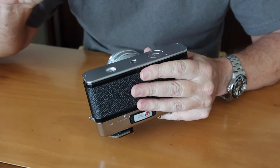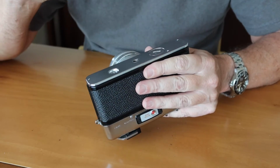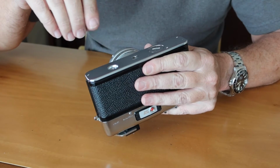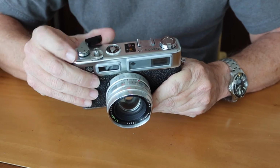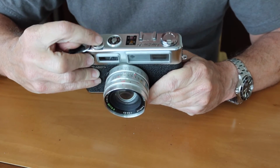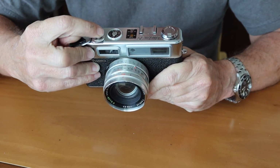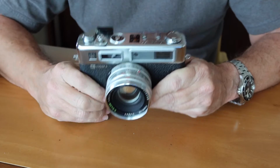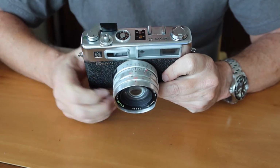So what you do is you put some drops of naphtha or Zippo lighter fluid or whatever you have like that. Put quite a few drops on it, and then turn the camera upward and hold the shutter like this and just cycle the shutter a few times. And the fluid and the friction of the levers will clean off any gunk which is on the contacts. And then the buzzing and funny noises will go away, and so will the flickering lights.